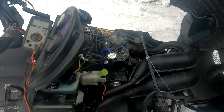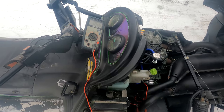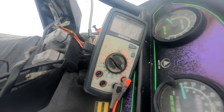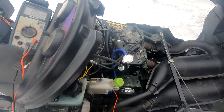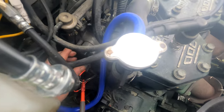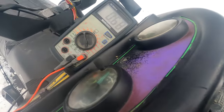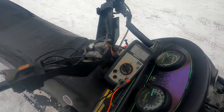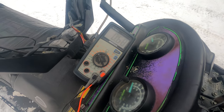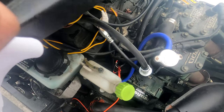Turn on your voltmeter to volts. You'll see mine is at 0.68 because I'm one step ahead of you. You turn on your voltmeter, undo the screws, slide your hand in, and you're going to twist the sensor with the screws loose until you get 0.538 volts or 0.54 volts on there. That's the first step. Now leave that alone and tighten down those two Phillips screws.